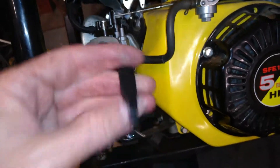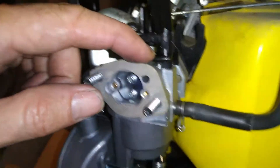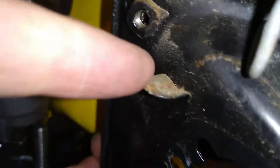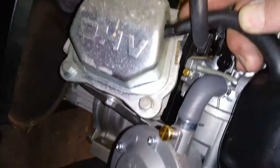We nearly forgot one important thing — the choke handle. The choke handle needs to be fitted because it is held in place by the air cleaner housing with that little tab there. My finger sits on top of the choke plate, and the choke handle holds it down. The air cleaner main housing is on. We've also got this crankcase breather hose which comes from the top of the timing cover and sucks the gases out of the crankcase into the air cleaner — probably an emissions thing. Push that back in and we're done.